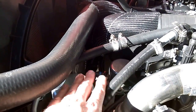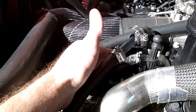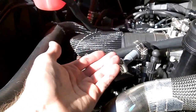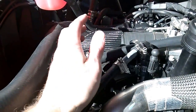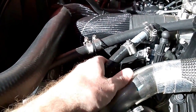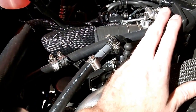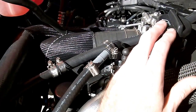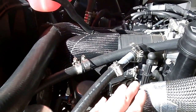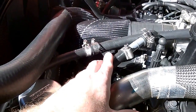These readings are predetermined in the factory map and you cannot manipulate them electronically or by putting in resistors. What you have to do is duplicate and replicate that flow. Your flow will be interrupted when you put this in. As boost increases, your flow is going to increase because your pressure increases from your crankcase blow-by naturally. There are two codes you're going to get: P04DB and P051B. P051B is a kind of scary code — that is pressure in your crankcase. If you ignore that, you're going to blow seals out. Four PSI is the blowout pressure. The system normally runs between 2 and 3 PSI.